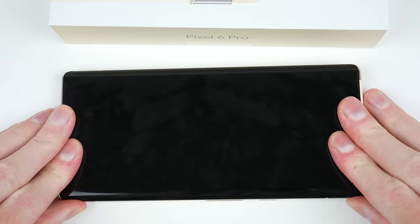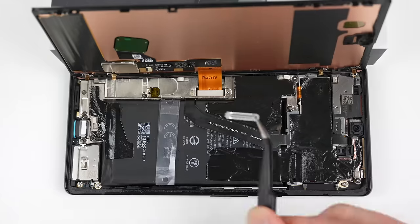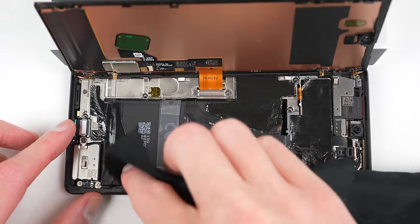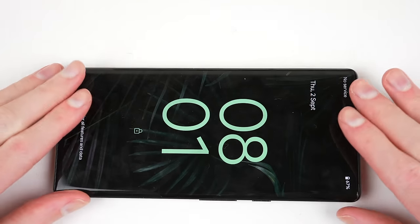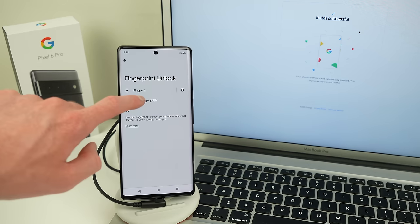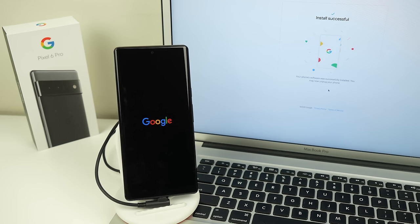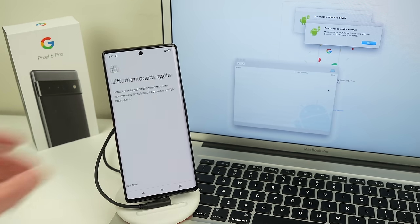After attaching one display, it's time for the last phone. Its flex cable can be attached along with its retaining bracket and screw. After wiping down the insides with a microfibre cloth, we can close up the screen and clip it into the frame. Having swapped everything back, the display for the black phone now had to be recalibrated, as we had calibrated it for the cream phone's display earlier. I had to perform this twice before the fingerprint began to function again. After reassembly, both phones are fully functional.